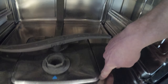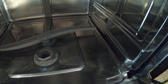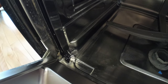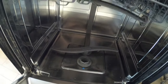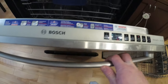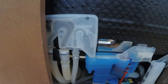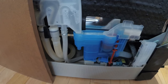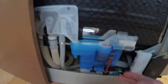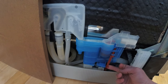It's about two inches right now. As soon as it turns on, it recognizes the water level is too high. We've gone from about two inches and it's going down. If I cancel the cycle and close it, it'll keep draining — and that's about as much as it will drain on its own. If I hit this float manually, I can also get it to drain out more than the dishwasher will do by itself.